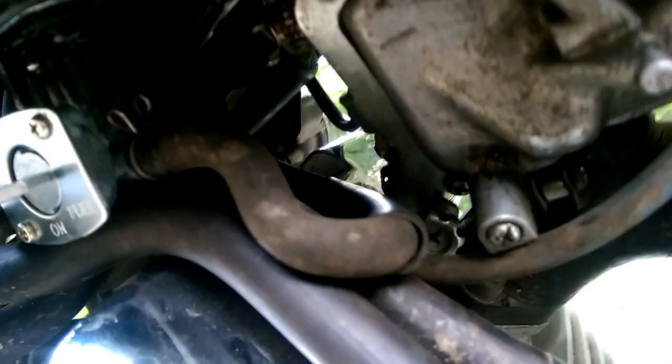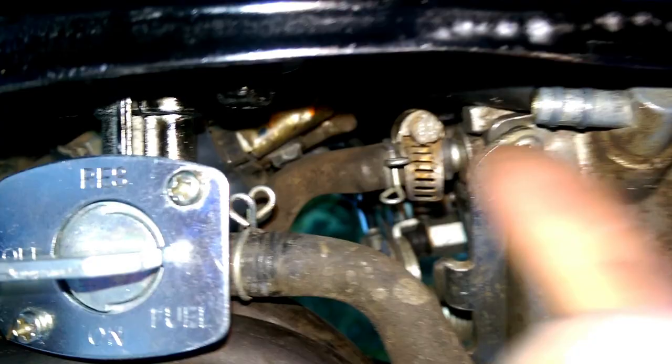I ended up going with the factory hose that was on the fuel pump — the third hose. It's got a little lip right here that sets up against it and keeps it from rubbing the hose into your fuel line. I've got one clamp on that and the top part double clamped. And I almost forgot to hook that hose back up — that's no biggie, I'll do that right now.